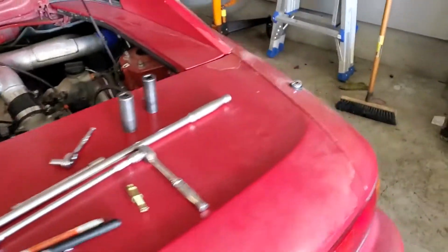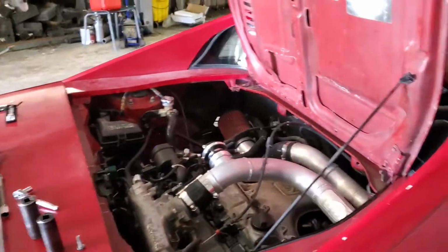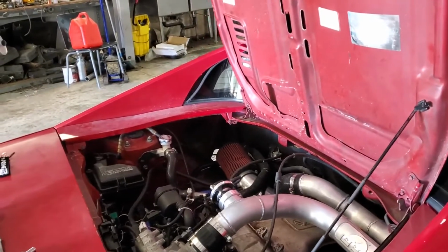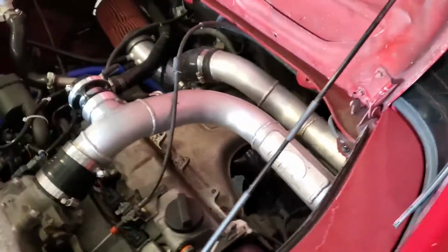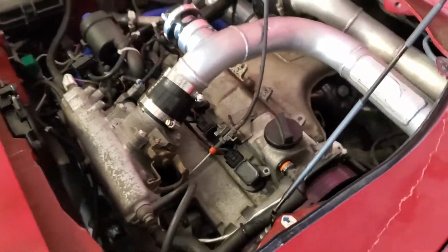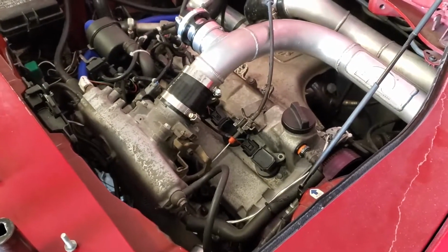So if you saw in that earlier clip, I actually got the car on the dyno for the first time, and we had a bit of an ignition timing issue. What it is, I'm pretty sure that the mechanical timing is off slightly because of my original settings, and I'll go over that here in a second in the software. Although I'm not getting any errors in my ignition signals, they're syncing up correctly, full RPM sync.